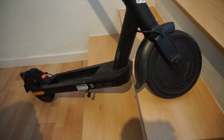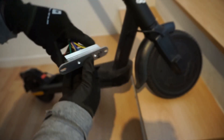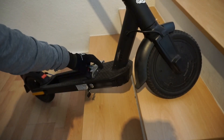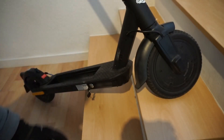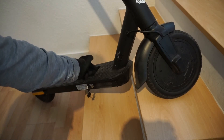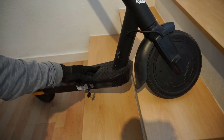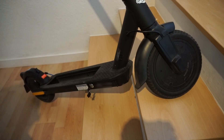You just do all the process in reverse. One other thing I noticed was that on the replacement controller there was a metal plate attached, and when the plate was on it actually didn't fit — it was too wide. I was luckily able to unscrew it and then the controller was able to slot into the old position. It also slots on this other side of the plastic cover, so make sure you put it back the same way as you found it — document it with pictures.